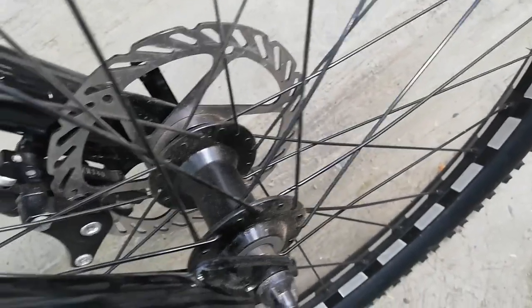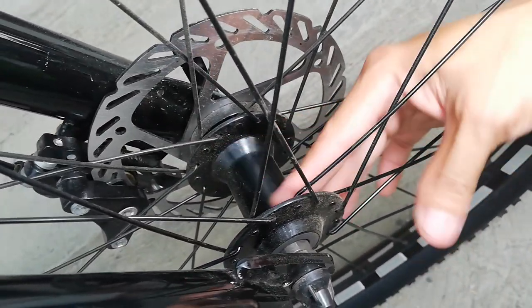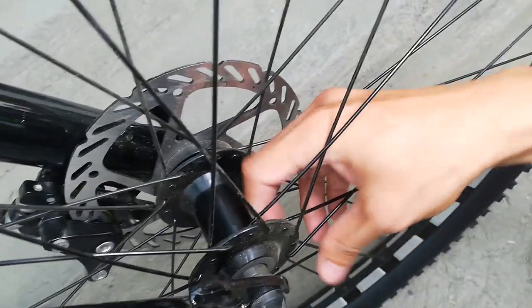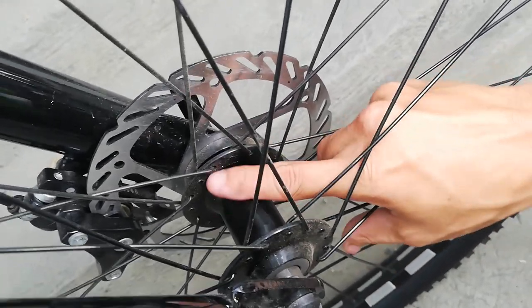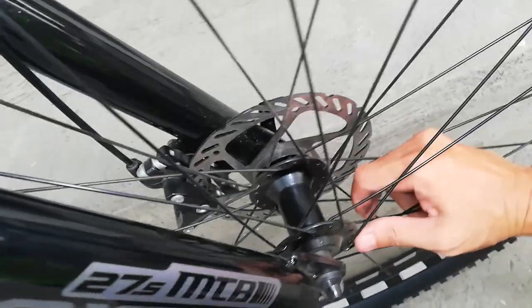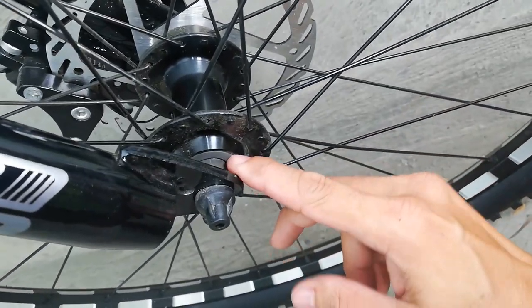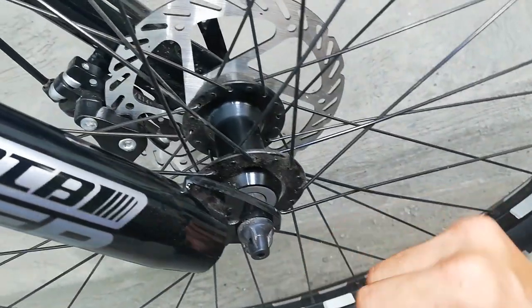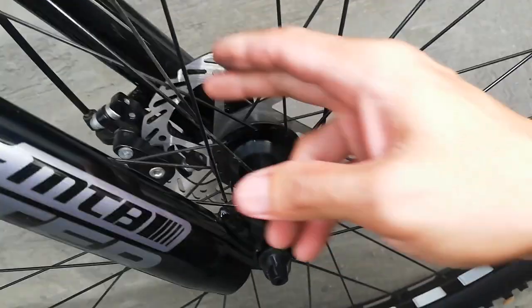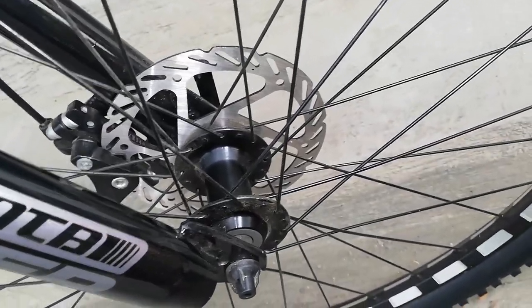Now the hubs — testing with a magnet and no stick, so these are alloy! A quick tip for beginners: if there's a seam/weld line, it's steel; if it's one-piece, it's aluminum alloy. The bearing is a traditional ball bearing type. It's a quick release hub. Counting the spoke holes: 2, 4, 6, 8, 10, 12, 14, 16 — so 32 holes on our alloy Foxtor-branded hubs.